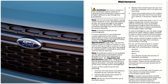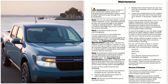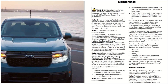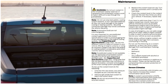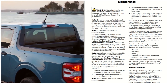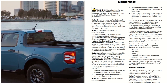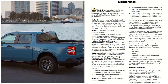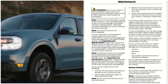Mixing engine coolant or using an incorrect coolant may harm the engine or cooling system components and could void your vehicle warranty. If pre-diluted coolant is not available, use the approved concentration coolant, diluting it 50/50 with deionized or distilled water. Using water that has not been deionized may contribute to deposit formation, corrosion, and plugging of the small cooling system passageways.